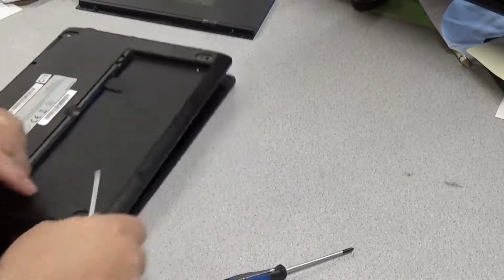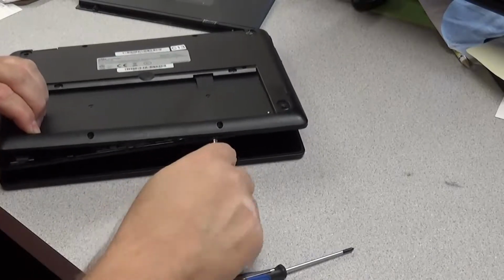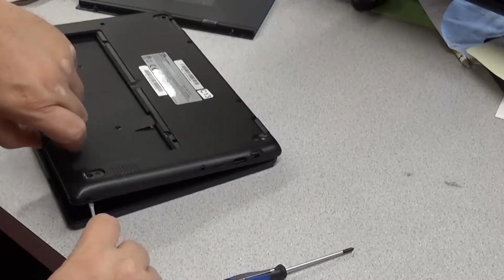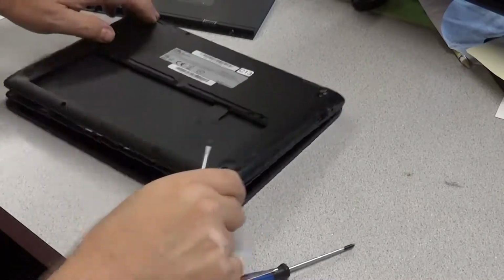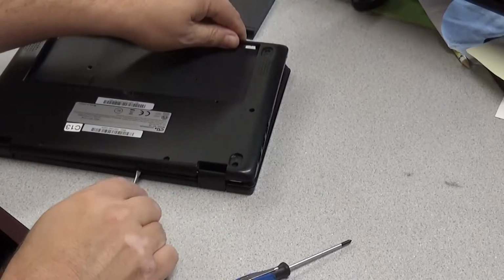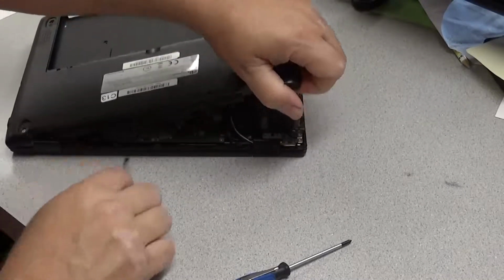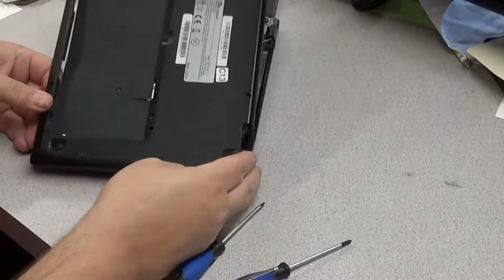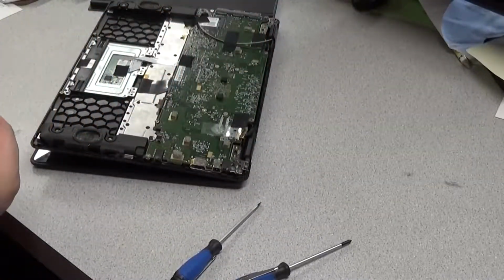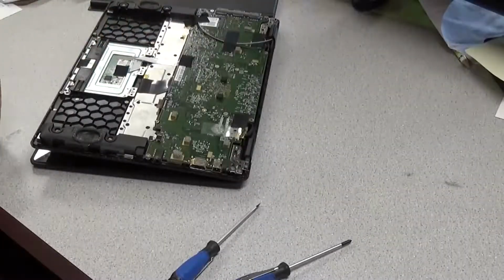The reason I start on the back side is if you do make a little ding in the plastic, it's better to have it on the back than on the front. So once it starts going, it's fairly easy. Just slowly, carefully maneuver. As you can see, I'm moving the screwdriver through till it gets to a spot where you feel the clip is, and then you get in there and you just pry it, very gently. Now it looks like I'm doing this pretty quick here, but actually I've sped up the video by almost 2 times, so I was actually going quite slow. And those are the things that stick out that cause it so you can't start on that side. There's also one screw that got stuck because there is a little bit of a grounding thing there, so I left the screw in.